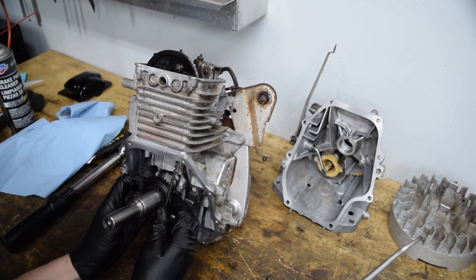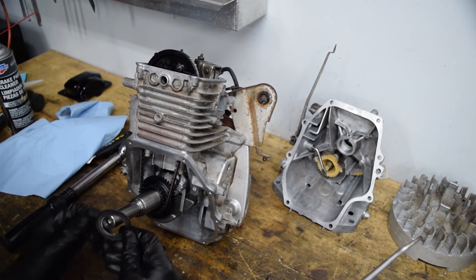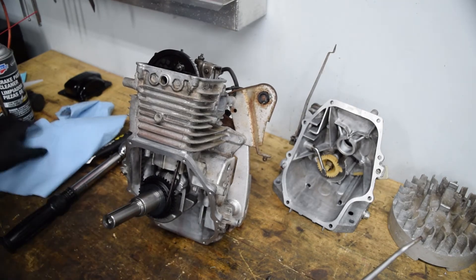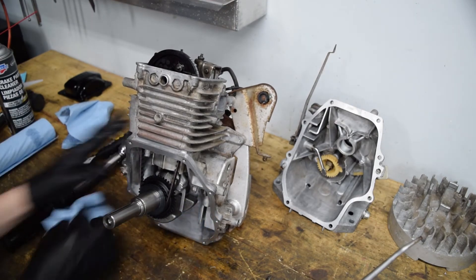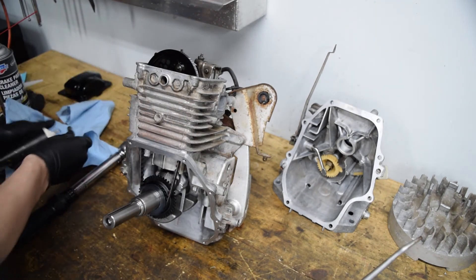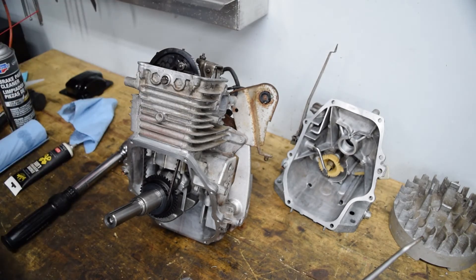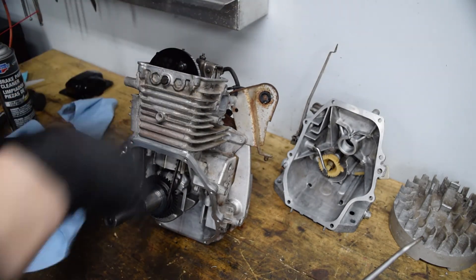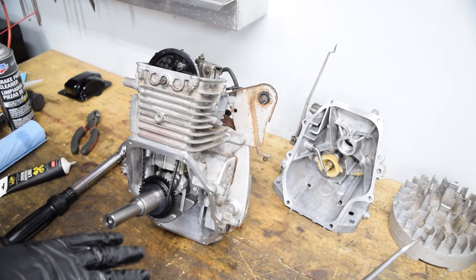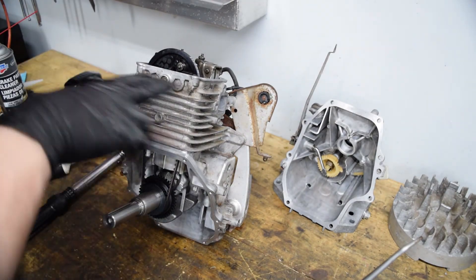Make sure it's nice and seated. Use the convex side down onto the cam gear, then drop in this dowel — which also gets assembly lube. This is tilted a little bit so we just rotate it like that until it's nice and flat, and that'll allow the valve cover to sit on top of it. Before I even RTV, I'm going to rotate this by hand about four times just to make sure it keeps lining up timing-wise.